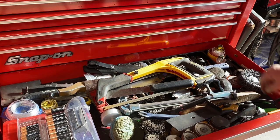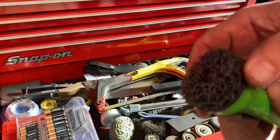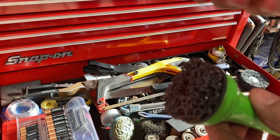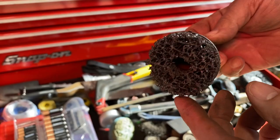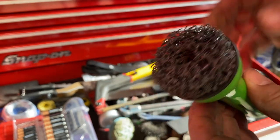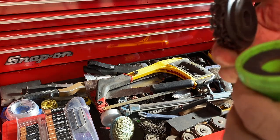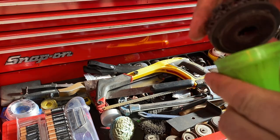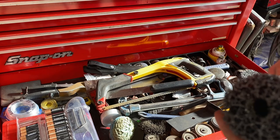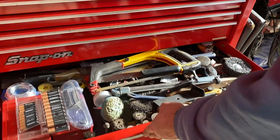I use these here for studs on your wheels. When you take your wheel off, you usually have a lot of rust around where the studs are on the hub. So this one goes over the stud — you just use a little battery drill and clean up your hub. Works very well. You can change these — there's a little Velcro that holds it on, slots into a groove. You get various ones like that — larger ones, smaller ones — and that works very well. Makes it much easier to clean things up.